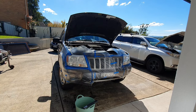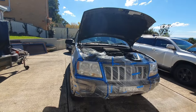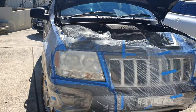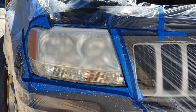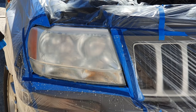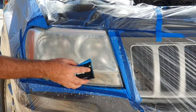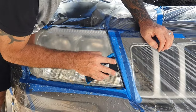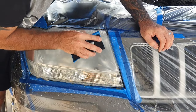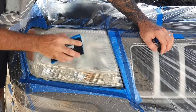Just make sure the camera is still rolling on the area you want to capture. So you can actually see the lens better. This is 800 wet and dry. All I'm doing now is the same process — the 800 has just taken all the scratches out that the 400 left behind. It doesn't take as long as the 400 did.